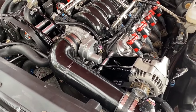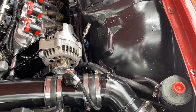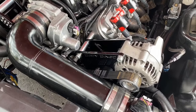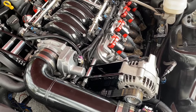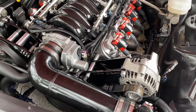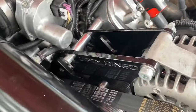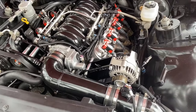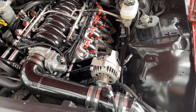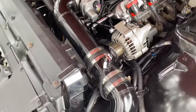On the power steering pump, if you're using the F-body pump you can keep the reservoir on it. I did have to move mine because of the bracket with the new LSA adapter front accessory kit - I switched from a low-mount alternator up to the high mount. You can use your stock third-gen lines, put them on a vise, and carefully tweak them - run the high pressure up or under and hook back around. It threads right into the F-body LS1 pump so you don't have to change any lines, and the low pressure is just clamped rubber hose.